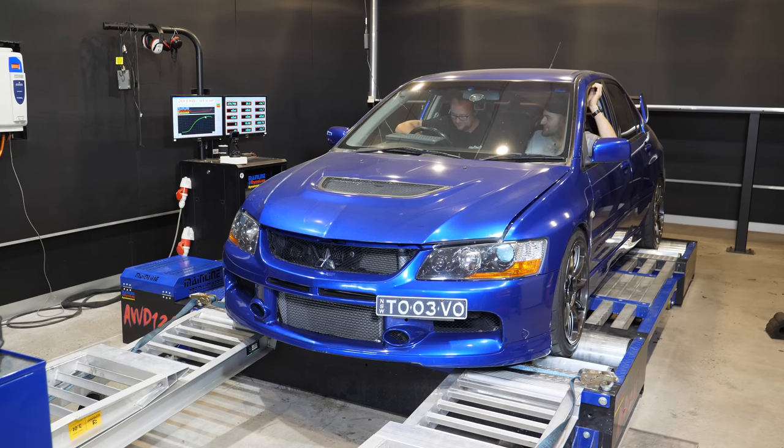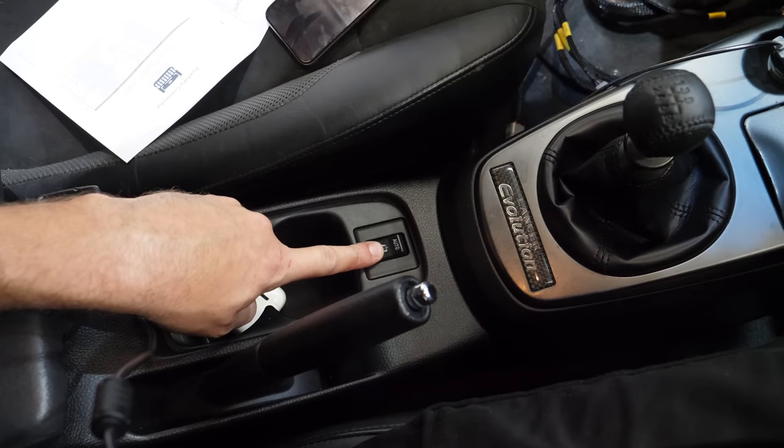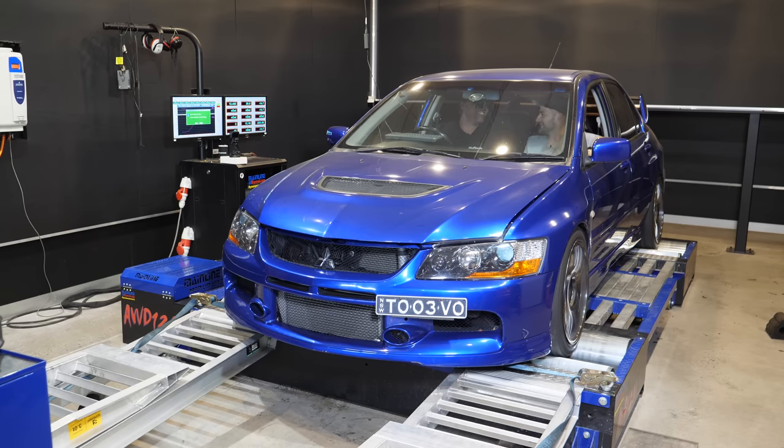Famous last Evo words. This is how the intercooler spray is working. When it's off, it's targeting 18. When it's on, it's targeting 22. Yep. And then you just hit the page up. Well, you want the number, don't you? Everyone wants the number. Not usually, but this time I do. So nice, because we're within 2%, 3% of it. It's so nice and smooth. 3, 2, 1, fire.